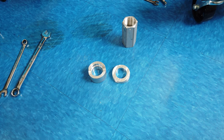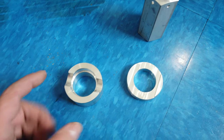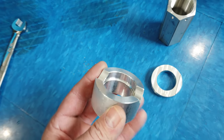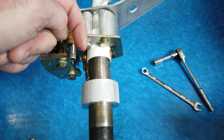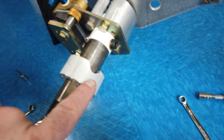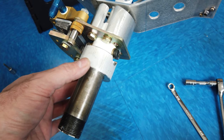Here are the spacers that come with the Sky Designs kit, and this is the new nut for the axle that they also supply. These two spacers are completely different. The larger one has cutouts across it for the axle bolt to clear, and on the inside it's machined with a shoulder. This slides on the axle, and the Vans-supplied part fits down and rests against that shoulder — bottoming out against it. The cutouts clear the bolt on both sides, fore and aft.